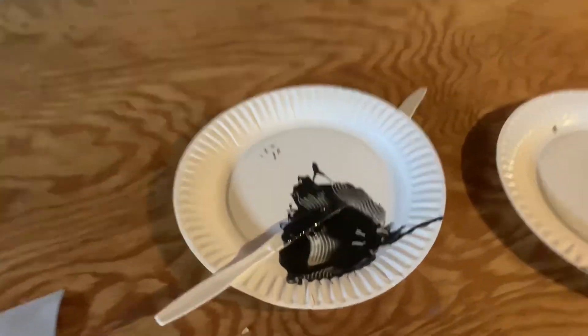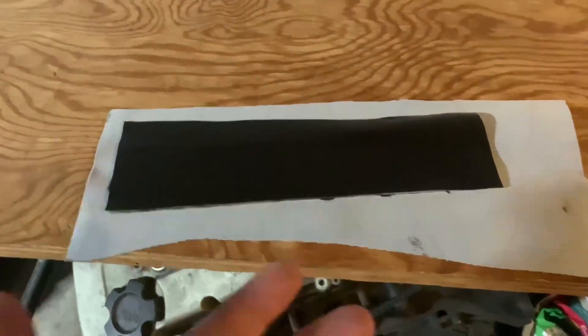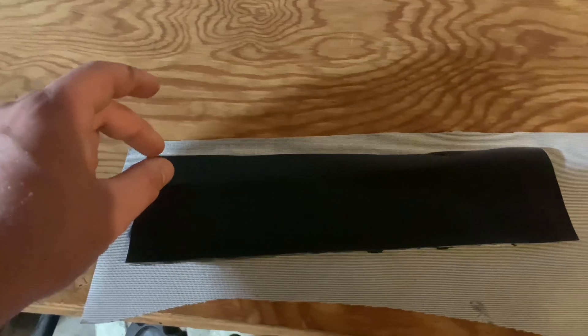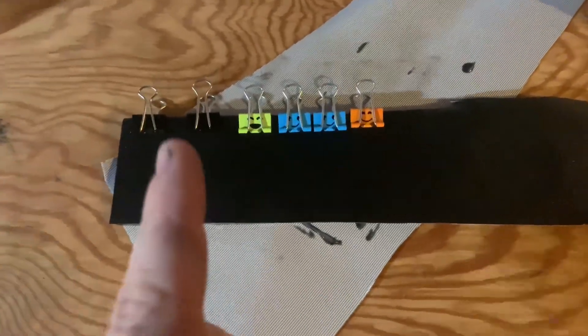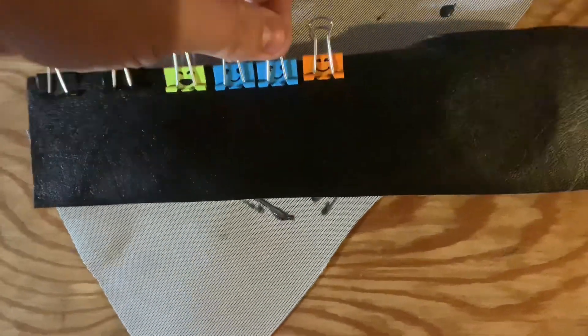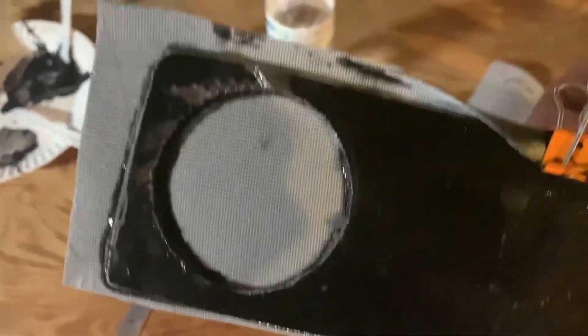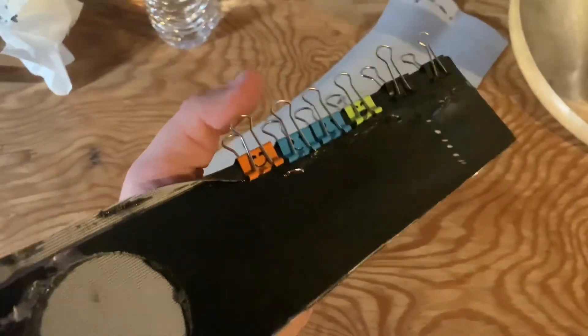Although this doesn't look beautiful right now, we have our first gauge hole in. Remember that now I'm going to take the fabric and lay it over this and see how it looks. I think it's going to look pretty good in the truck once it's all said and done. So inside the house I've taken some JB weld and applied it to the top of this. I've actually only used JB weld once — probably isn't the most perfect thing to use, but if it works, why not? We're just going to put something heavy with some weight on it, then come back, fold that lip at the top, JB weld the back of it, and hopefully it stays. I would just like to say, if anybody was doubting me, this is actually coming out pretty sick. The JB weld is super strong and I'm using these little clips to overlap that top piece of pleather — fake leather, or vinyl, maybe. It's coming out pretty good. I just got to do the second half, cut out the hole, and we will be good to go.